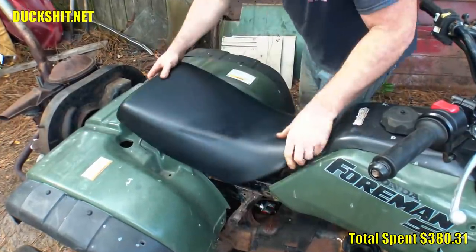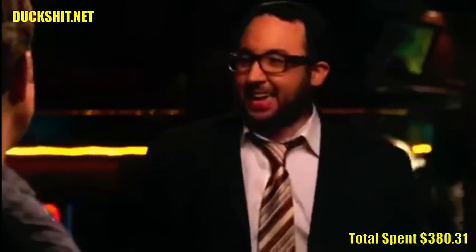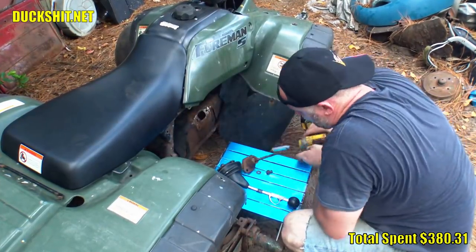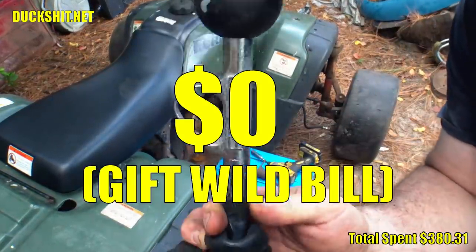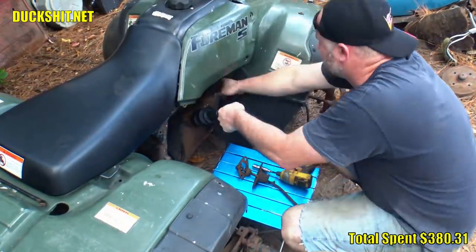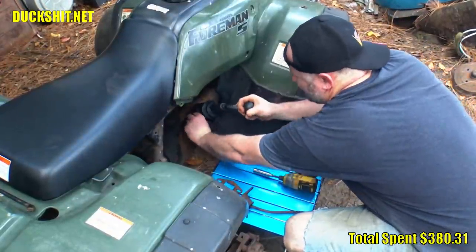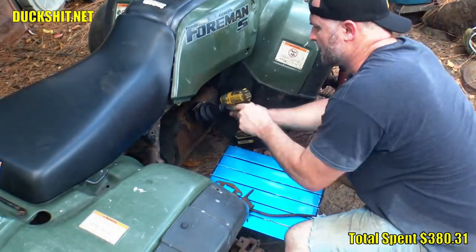While I had the welder out, I also made a proper clip to attach the seat to, as sitting on the frame was really starting to hurt. And while I was at it, I replaced the shifter — it just kept popping up and out of the shift rod cup and spinning around, making it impossible to get it into any gear at all. I remembered Bill gave me a shifter recently, and eventually it's going to end up on Eleanor, but in its unknown condition I figured I'd give it a try and it works great! So thank you, Bill! I'm still looking for a proper bus shifter to fit on here, and Declad Don actually called me this week about it and said he had one. I'll be seeing him this weekend at tech session and maybe he'll have a shifter there for me.